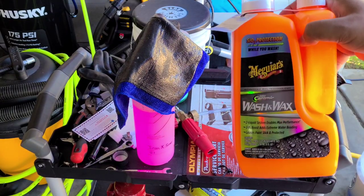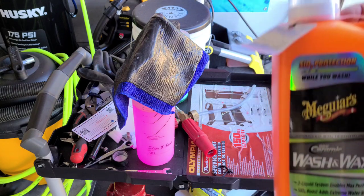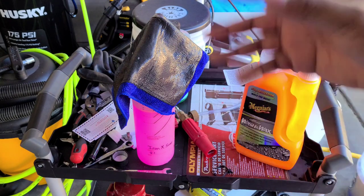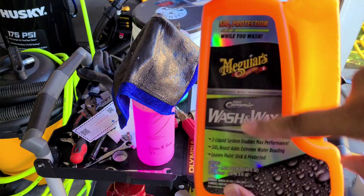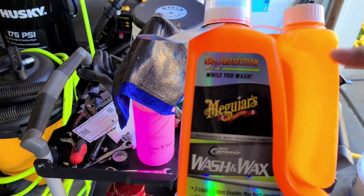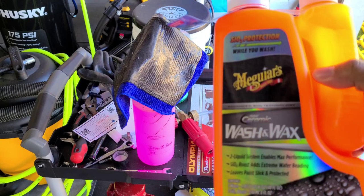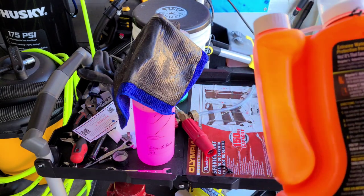I have used ceramic soaps before. I have a CarPro Hydra 2 foam that I use for ceramic-coated cars — that product works amazingly well, beads up like a monster. I've also got Turtle Wax Hybrid Solutions; that one is a sheeter. I like beading because I like to use forced air to dry my car off. A little bit about this product: it has the main shampoo and the SiO2 boost separately. The SiO2 boost is kind of like a concentrated ceramic detail spray — that's where the beading comes from. Ceramic soaps don't foam up a lot because the ceramic polymers kill the suds, but it will still clean.